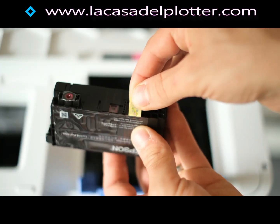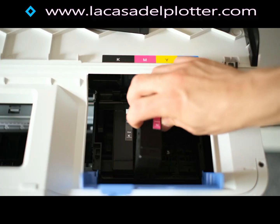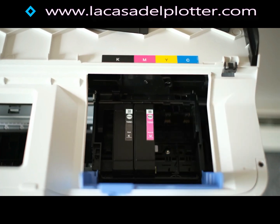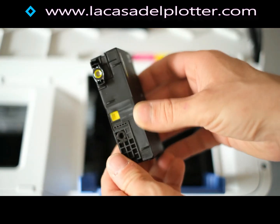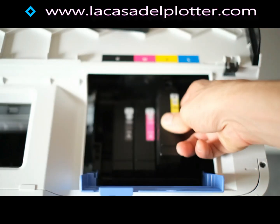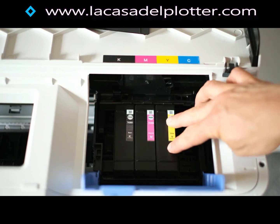Also, under each ink, there's a yellow piece of tape. We're going to want to go ahead and pull that off. Then we can go ahead and put in the ink cartridges into the correct bays on the printhead. Make sure that the ink cartridges are facing the proper way when you insert them. And again, follow the correct order of the colors from the diagram.